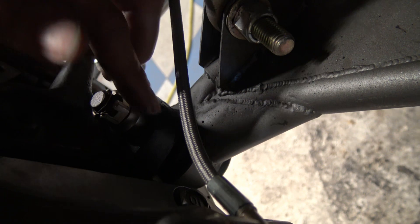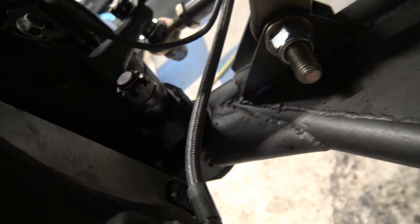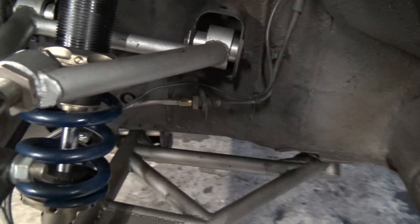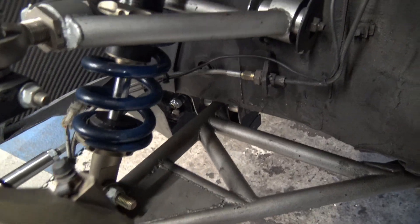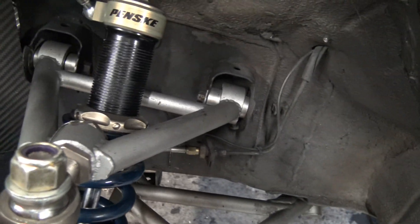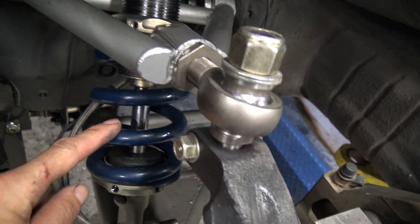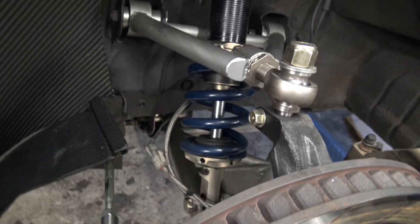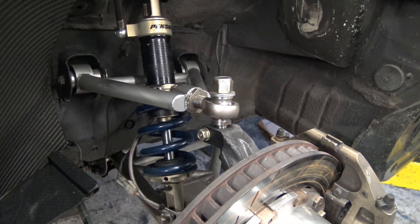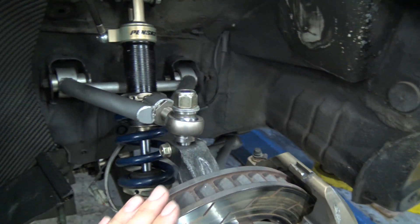It uses the same degree taper as a K747-style ball joint because I wanted something ultra heavy duty to handle forces of over 2G's through corners and bumps. The Penske dampers are ultra amazing — these are four-way adjustable with high speed, low speed, bump, and rebound adjustment. Right now I'm running 2200 pound springs — very stiff springs. There is no sway bar front or rear; that's something I'm going to add. I'll be putting on blade-style, cockpit-adjustable bars that I can change from inside the cabin.